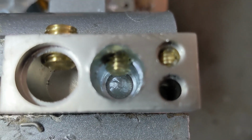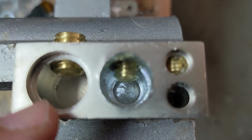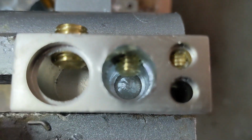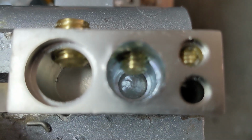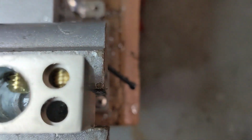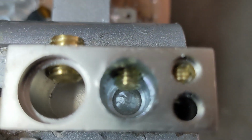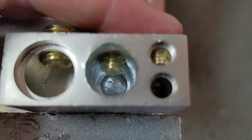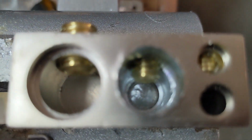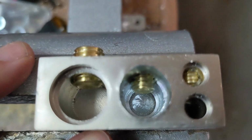We'll see. Anyhow, to the real technical aspect here, if you look at this, it looks like this hole is still bigger, but that's actually an optical illusion because there's a step here. I run my finger right there. See, there's a step. So the actual bore size between these two is actually now the same, where it didn't used to be. And just a quick look here as I put an eyeball on everything, I believe that it's okay as far as thread engagement with these set screws. It should be enough to hold the cabling securely with enough meat to keep the side of this from potentially splitting or anything of that nature.